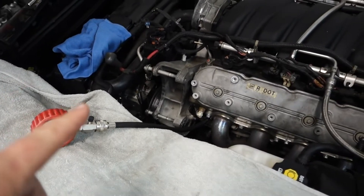We're done testing cylinder one — we got 220 PSI. Now we're going to swap the tester over to three and repeat the process. Your numbers may not be the same; obviously every engine is going to be different, and the cam in this may be affecting those numbers as well. Basically, what I'm looking for is just consistency across the board. I don't want to see too much more than a five PSI difference between cylinders, just to make sure this thing is healthy.